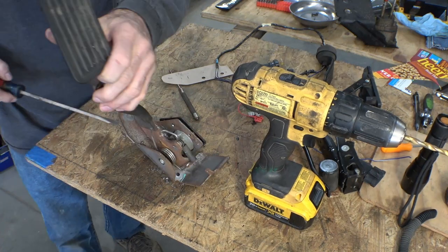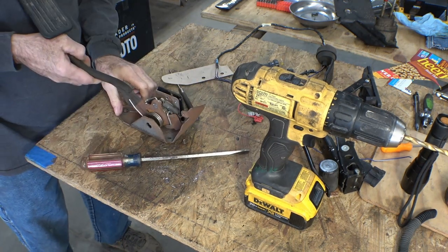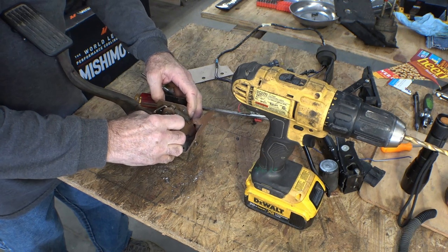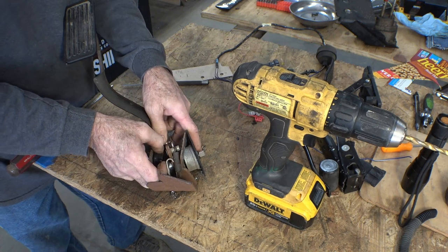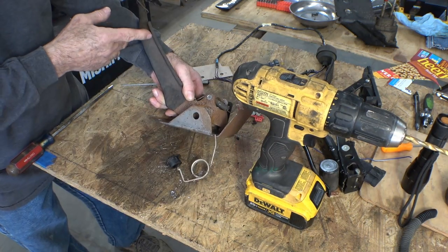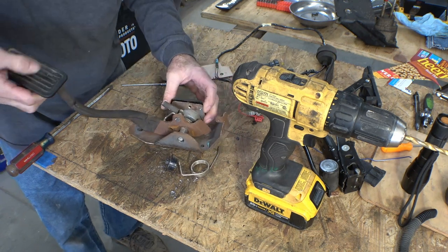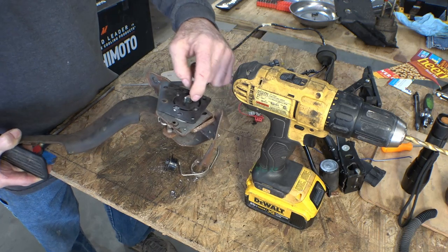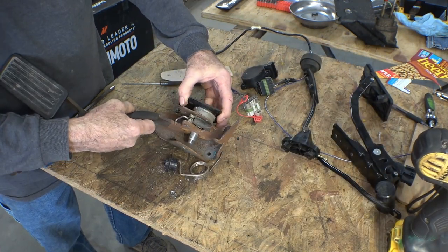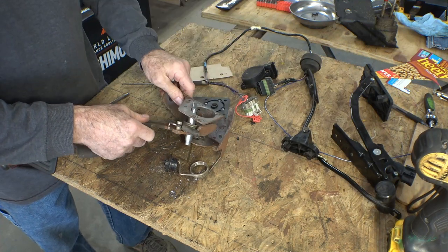This still seems to be a bit stuck — but it's nice and loose now. I'd like to get this bushing and spring out of the way — and there we go. That bushing had to drop back into the hole in the center in order for this to clear. Now that's out of the way, gives me more room to work with and I can see what's going on in here. It doesn't appear to be any spring pressure, anything like a spring coiled inside of here, so this is going to slide off and not have anything shoot off into space. Yep, it's completely hollow inside — just a bushing for it to ride in.